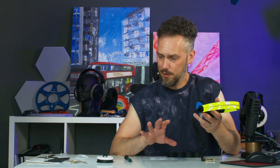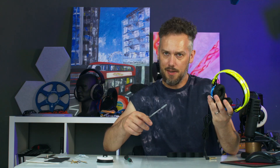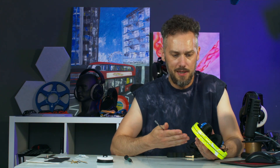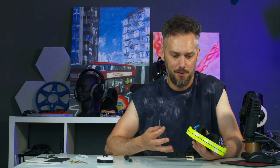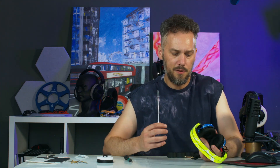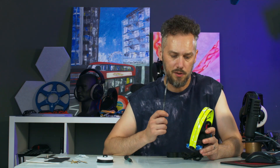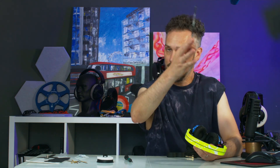So there you go — the new v2 Sennheiser HD25 mass loading and damping kit. It's good to phase out that old one. We've been doing that for 13 years and it's lead and bitumen-based, not as nice, and takes ages to fit. The new one is more effective, gives a slightly better frequency response, fits a lot quicker and easier, and there's no lead or dangerous heavy metals involved. It's going to be a little more expensive because we've had parts specially CNC machined, laser cut, and stamped, but I'll try to make sure it's not crazy money. Check out the link in the description, and it'll be available as an option on our custom headphones. Thanks for hanging out — see you next time.